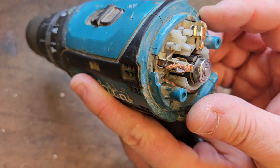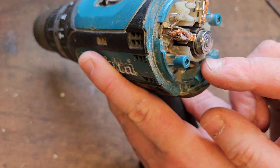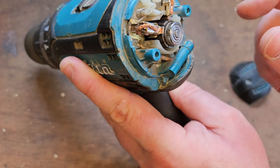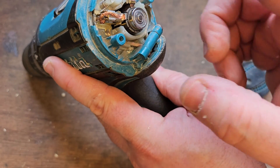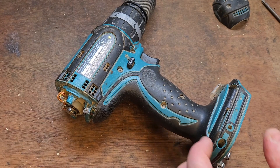The burn is okay, but we know the motor has expired — we need a new one. There's no melting on the brush holder, so that's good. We can probably save that and the brushes. It's just a matter of replacing this part of the motor, so we'll just start tearing this apart now.